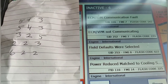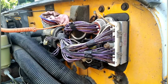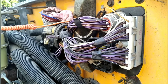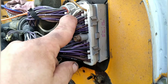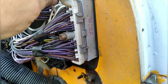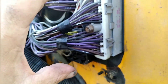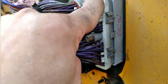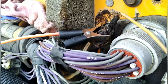I had to look up the wiring diagrams on the computer online — sometimes you get lucky and find them on Google with an image search. I pulled the cover off of here, and this is the ECM. I figured out that these were ground here, here, and here, and the power wire was right here. I unscrewed this until it came out, took my test light, and found out I had power and ground. This ground comes right here to the firewall — that's where I had my test light hooked up.